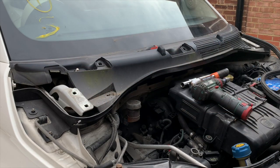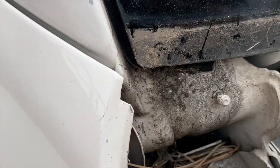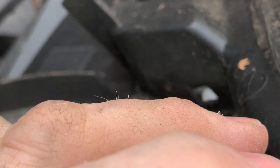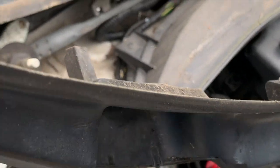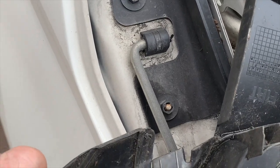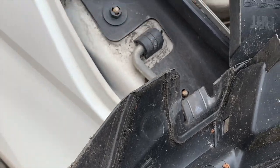We need a trim tool. These clips - on the underside of here you've got these little white clips, and these are the things that break. On the other side it has broken, so I'm going to super glue it back together. Because if those aren't intact - I don't know whether you can buy those anywhere as spare parts, they probably come as part of the assembly. You need to make sure they don't get broken, because once they go on and push on, the little teeth grip onto the thread. If that piece isn't there, it will just flap about.